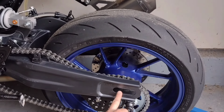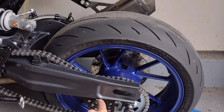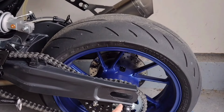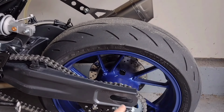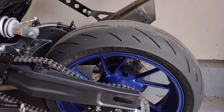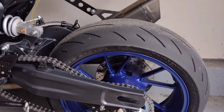So if you remember, I said grease up the threads, avoid that from happening, but also I will revise my torque that I'm using, dip back down to around 77 foot-pounds. Some would go even lower, but I'm going to stick with 77 foot-pounds on that for now. And then I'm going to show you some modifications that I'm going to do.